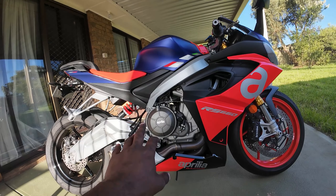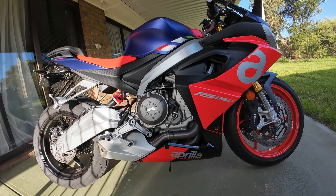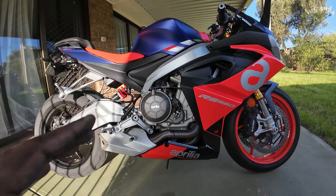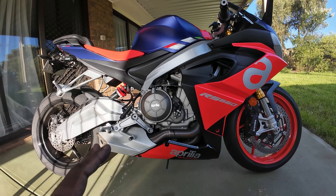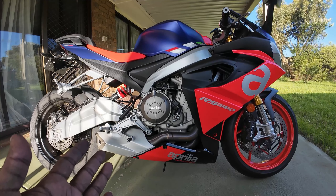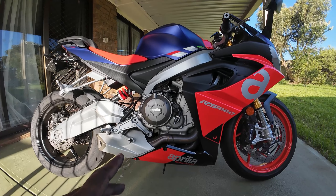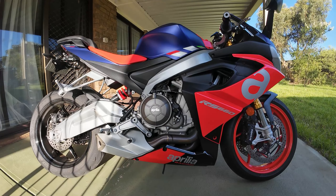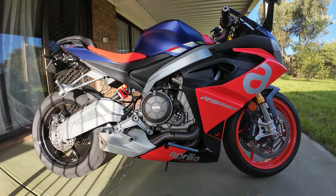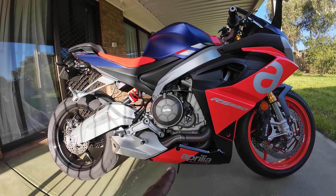We filled the engine with new engine oil, changed the oil filter, and fitted back all the fairings and the belly pan. Now the next important step is to check the engine oil level — that's actually a critical step because it's a totally different way to check it on this bike. You'll need to ride the bike for 10 kilometers. This is what Aprilia recommends: ride the bike for 10 kilometers to get it warmed up. You can't just idle it for a few minutes — you need to ride the bike for 10 kilometers, come back, make sure your bike is straight, and then check the dipstick.